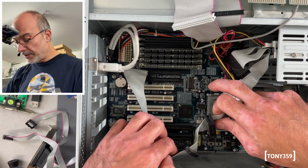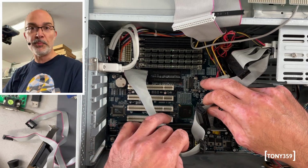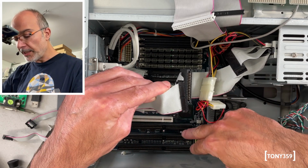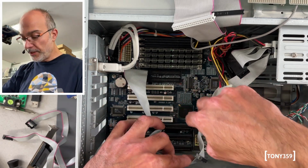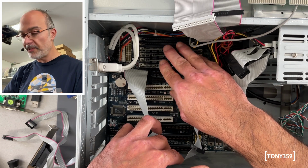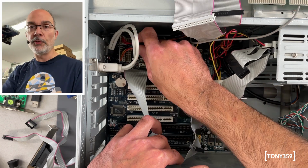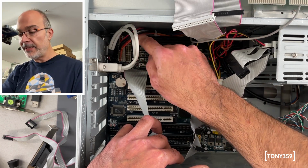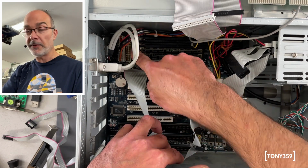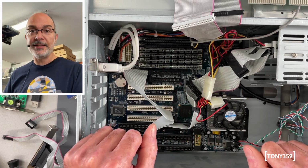And about the motherboard, it looks pretty nice aesthetically. At least I like the color. It's kind of a deep blue. We got 4 PCI and 3 ISA. We got Intel TX. We got 4 72-pin slots for SIMMs and 2 168-pin slots for DIMMs. This board is accepting both AT and ATX power supply. The current power supply is an AT. Right, let's see what's under the heatsink.